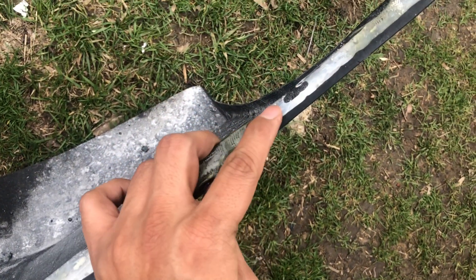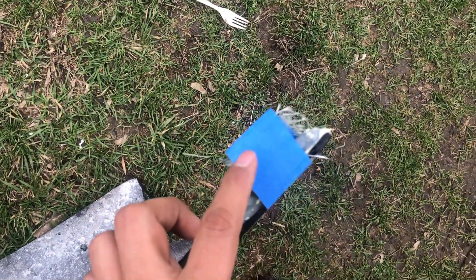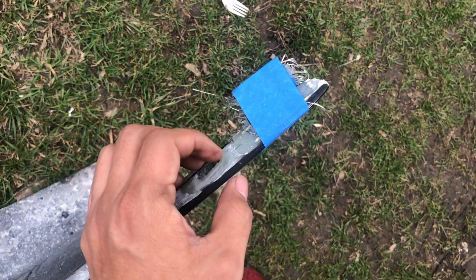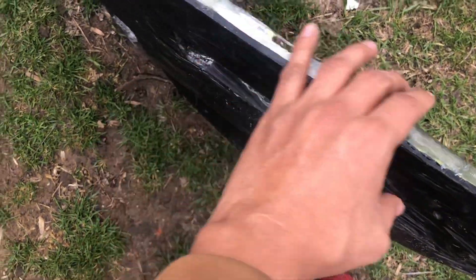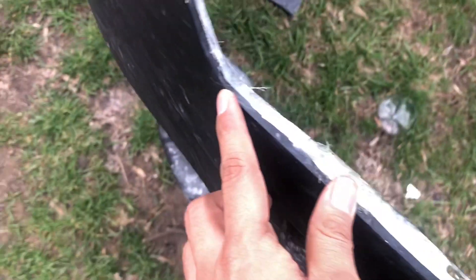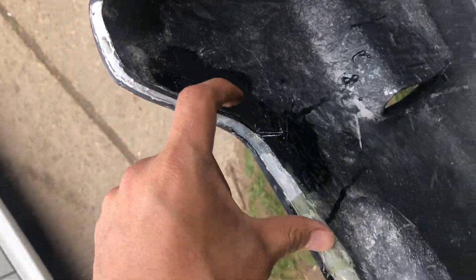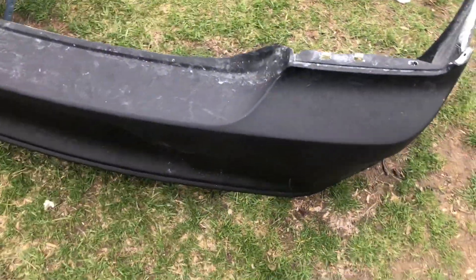Example: what happened right here — basically I'm refilling it with fiberglass. On this side they didn't give me enough fiberglass to make a hole. If you look at the other side — right now the challenge is this thing is not as durable as it's supposed to be, because if you push it this way you start getting cracks here. So I have to go back and reinforce it with fiberglass so it doesn't crack more.